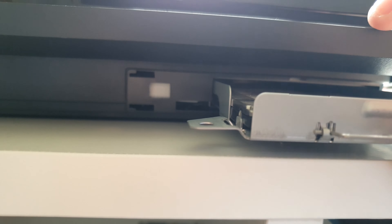This is a 160 gigabyte SATA Hitachi — it works very well, but you shouldn't cover the ventilation hole as it says. If you want to replace it, you gotta unscrew these four screws, take out the hard drive from the metal frame, slot in the new one, and screw back in.